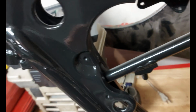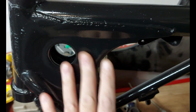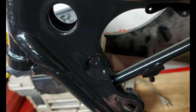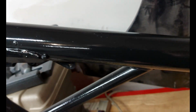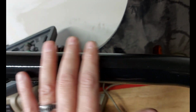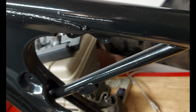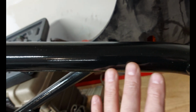Now, it doesn't matter on this thing. This thing isn't like a collector bike or nothing. I'm just trying to protect the paint. And I just wanted to see if I could actually do a decent job spraying. But the problem was that where I was spraying it, it wasn't perfectly dead air still. And that was the issue. It still had some sort of venting going on that was pulling the air through the spray area, and that's what caused the issue. So that's what we see here.